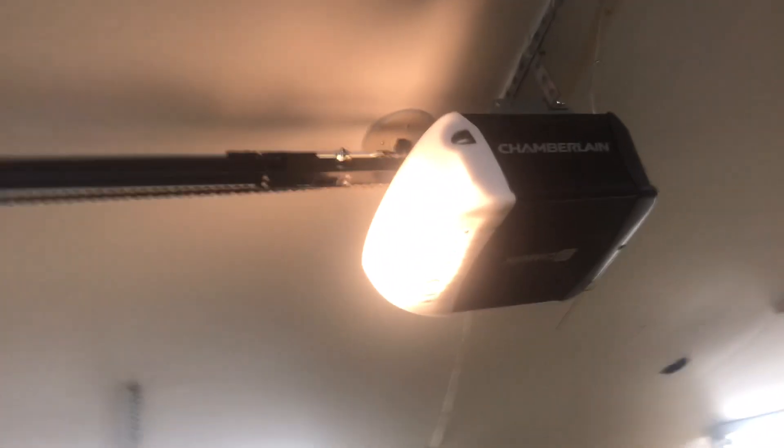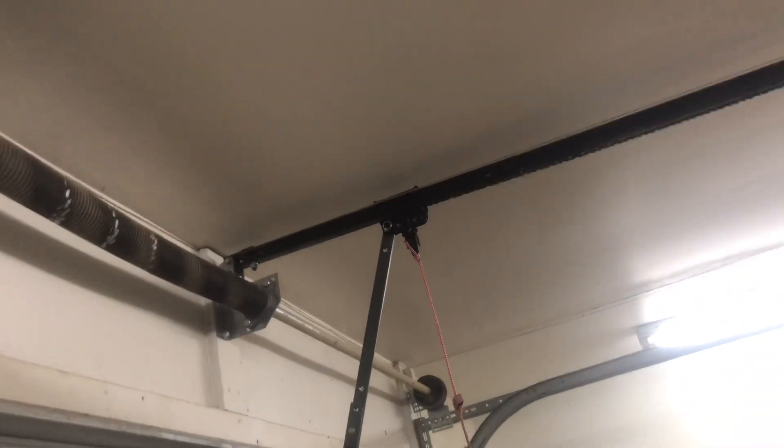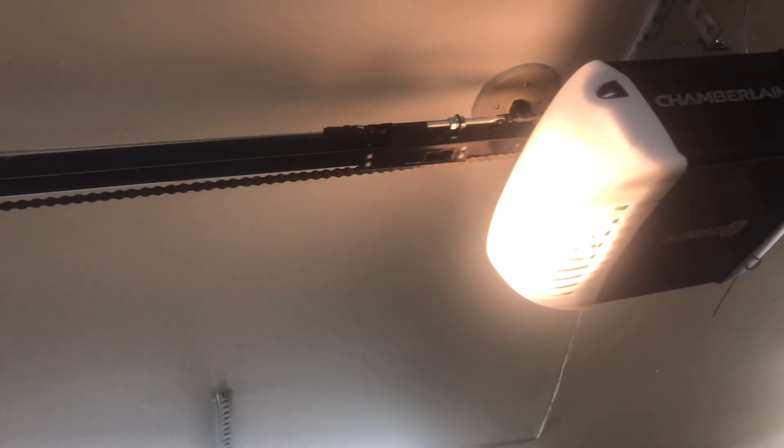The door is now disconnected. The piece on top of that whole arm is connected to this piece over here, and that little piece is what snatches onto the garage door opener arm. The way this trolley is moving is by chain. It's not a full chain — up here it's all cable, and over here is just a chain, so it's a chain and cable connected together as one whole unit.